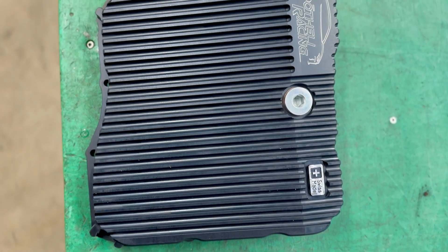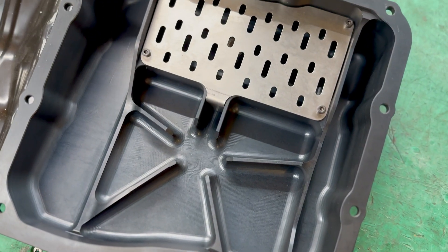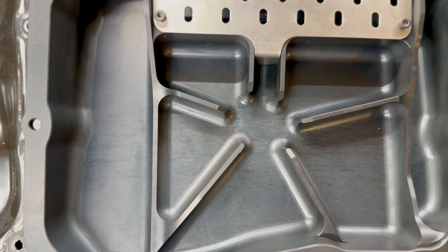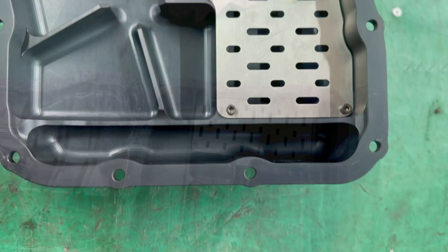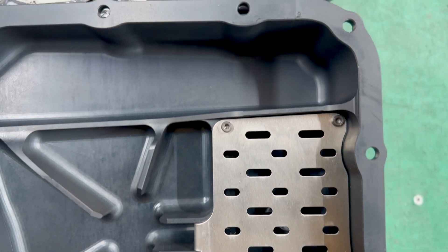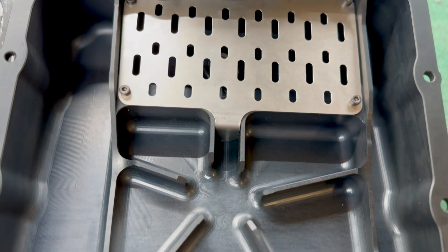We just filled everything up. With the oil pan and our oil cooler kit I'm now at nearly seven liters of oil. Stock is 4.3 liters; with the additional oil cooler you get roughly 0.8 to 1 liter of additional volume. The new oil pan adds another 1.2 to 1.3 liters — possibly a little bit more. I need to check when the car is fully hot and the oil cooler is properly filled; right now I just drove around the workshop, so I'm at about 6.5 liters.